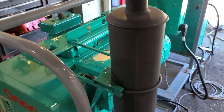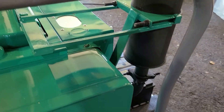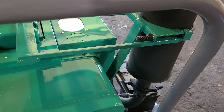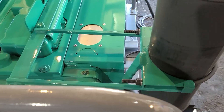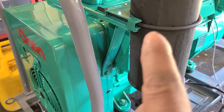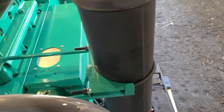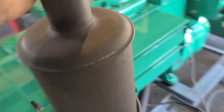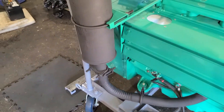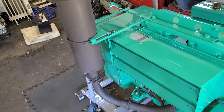The muffler system isn't really all that heavy. As you can see, we've got a nice bracket — over time it's going to get hot and the paint will peel, but we'll just paint it high-heat black. The main thing is the functionality: it supports both vertically and horizontally and it's strong. All that shaking is me with the camera, but I'm pulling on this thing and pulling the whole set. If the bracket were going to bend, you'd be doing other damage to the set as well.